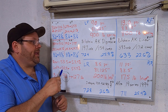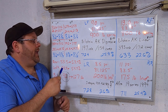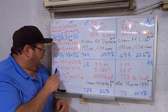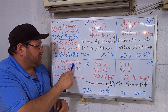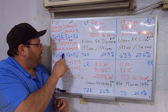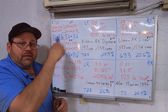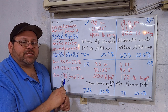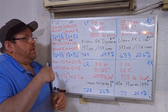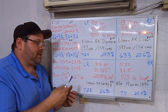I consider this setup complete for the feature race. I may add 60–70 pounds to the rear, which will push my rear percentage slightly over 54%. Ride heights will change by maybe a 1/16 to 1/8 inch on the rear, but it'll be even and the car will drive the same — I'll get a little more forward drive off the turn. I'll write this all down in the book with today's date as my feature setup.